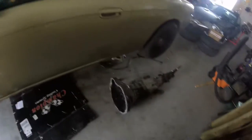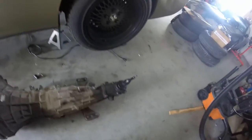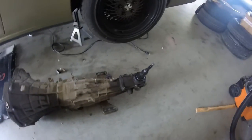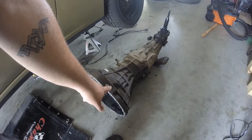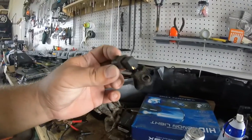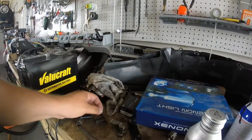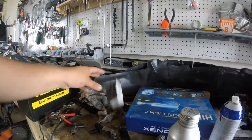What's up guys and gals. I got my S14 here with the transmission out. Something I didn't know about the S14 transmission — it has a crank angle sensor that mounts right at the very top, and that made it a real pain to get out because it was hitting the firewall. It has a little metal cover to protect the sensor, and even with the cover I managed to break it getting it out because I didn't know it was there. I picked up a new one from O'Reilly's — thanks to Shunk Cat for grabbing that for me.